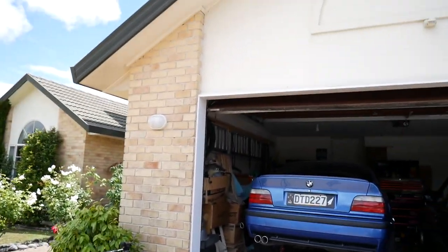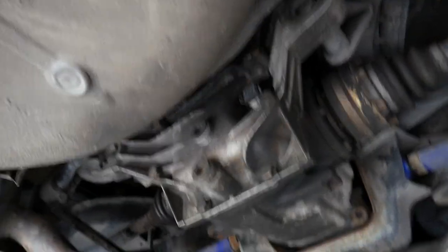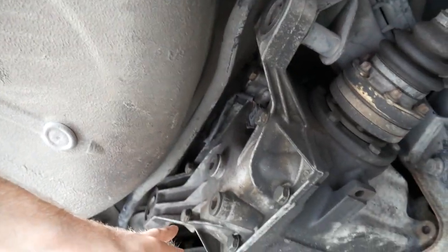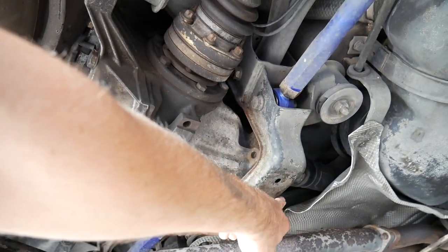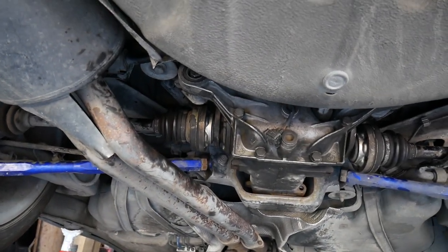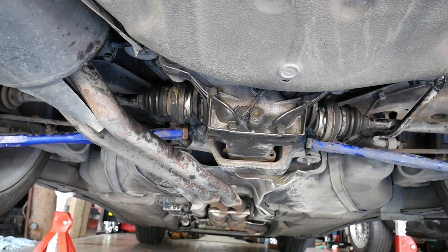First things first, we're gonna start with the diff and pulling that out. I've jacked up the car nice and high. Again, if you want to see a proper tutorial, check the link in the description. Basically what you have to do is pull out the speedo plug, undo the bolts to the sway bar and push that up so you can access the mounting bolts on the diff. You want to do the two mounting bolts on the back of the diff, one in the front, then there's the drive shaft bolts — disconnect the drive shaft from the diff and your half shaft bolts and it should all just come out nicely on a jack. All the half shaft, drive shaft and sway bar bolts are out. I've loosened all the mounting bolts on the diff, so now we're going to chuck our jack underneath the diff, bump it up a little bit to get all the bolts out completely, then lower it down and the diff will come out.